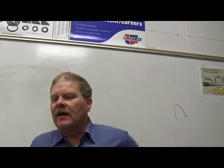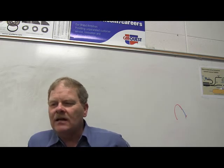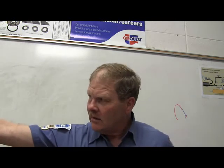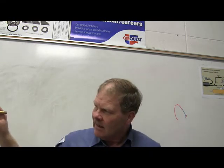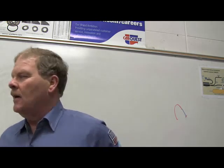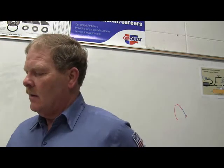And finally, number 25. Technician A says that if a slow acting instrument voltage regulator causes rapid vibration in the needle gauge, the regulator should be adjusted. Well, you can't adjust those. Now, the voltage regulator, like that one on the wall over there on that blue board, that square voltage regulator right there, those kind can be adjusted, but that's actually for the charging system, not for the gauges. The other kind, the solid state ones, you can't do any adjustment on.